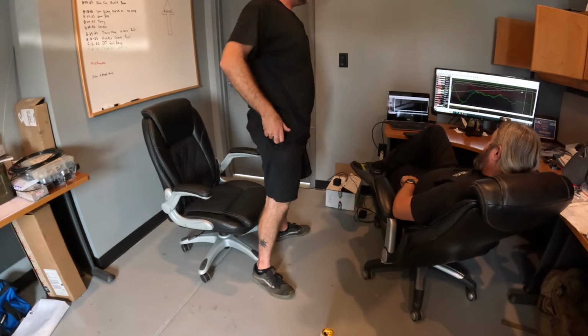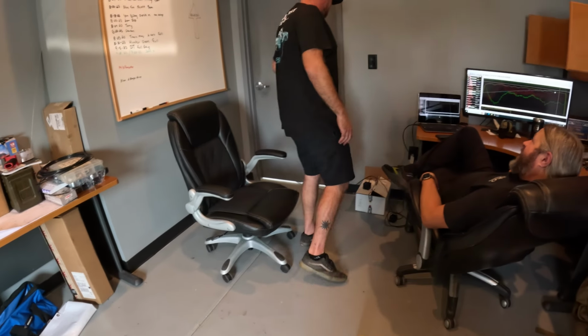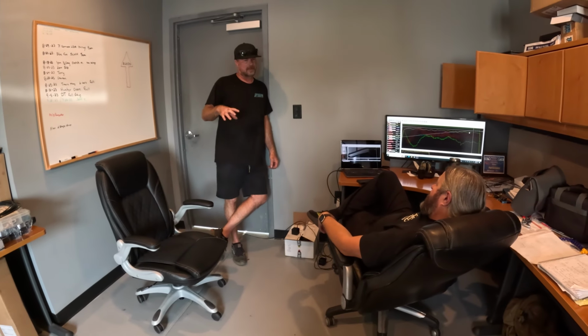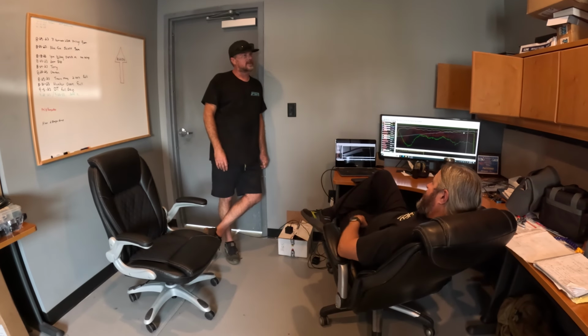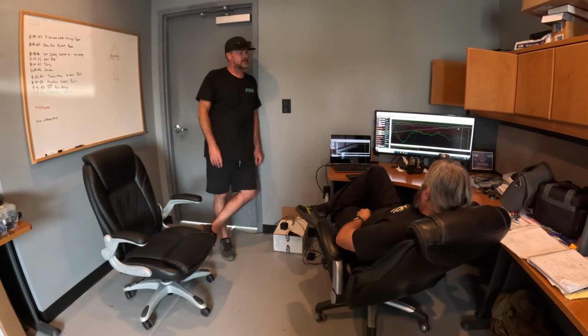What I wish we had is these headers with bigger collectors on them. When I was disassembling them today, the thing I would have liked to have done was go right in the middle: same primary tubes, but with a 4-inch collector. But I think these primaries are fine. If there's a restriction, it's the collector. I could get a set of collectors before it's ready. I don't know how badly that would screw up our tune.